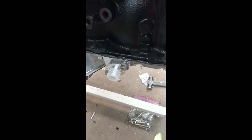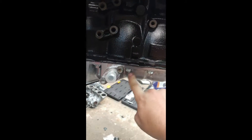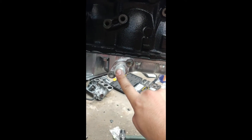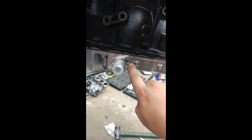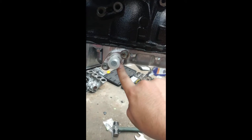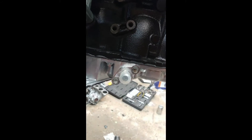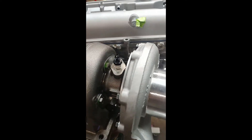One more point — this is a GE motor but with a GTE rear sump, so the hole is already pre-drilled and threaded for me. If you're using a GE pan you'll have to deal with that yourself. The kit does not come with the bolts — I just used bolts I had laying around. The kit only comes with the flange section with the o-ring. In the future if enough people buy it, I hope to provide the tools necessary to drill into GE pans, but for right now it's just the flange.